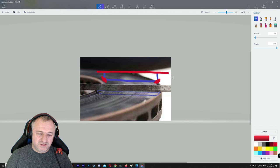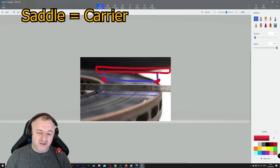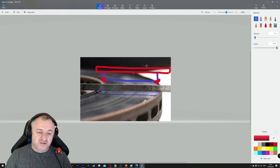But the problem with this is that the disc and the brake pad have only got a certain amount of distance allowed. Once the brake pad is worn right down, the backing plate will start going as close as possible to this disc, and if this disc is also badly worn, metal and metal start scraping. Eventually this metal piece will come out of the saddle and end up in the road, and then the piston will fall out. Stick to the recommended 19 millimeters on this model. Different vehicles have different settings.